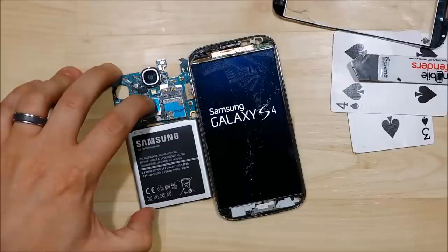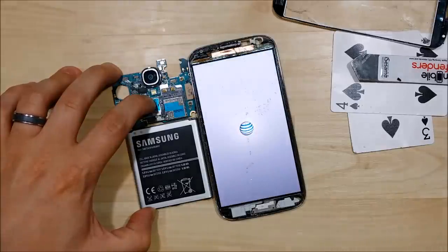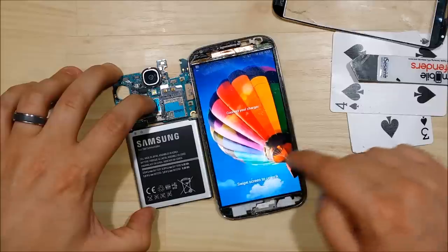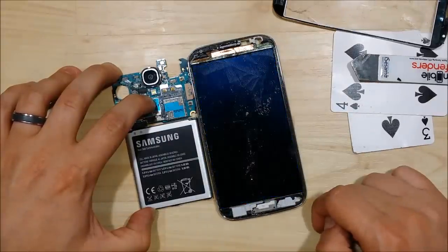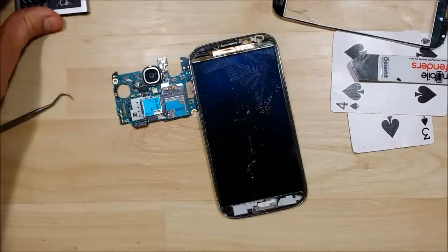The digitizer is attached to the LCD screen on this particular phone. The next thing we're going to do is remove the LCD from the housing, then stick it in the mold and glue it back in using the UV glue. If you found this video helpful, go ahead and hit the like button. If you want to follow the remaining process, click the link in the bottom right-hand corner — that'll take you to the next video in this series. Thanks for watching and see you on the next one.